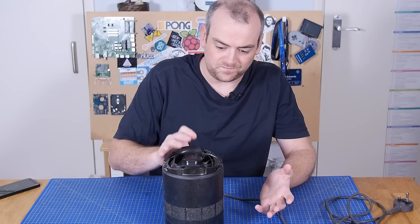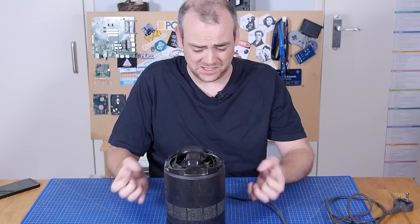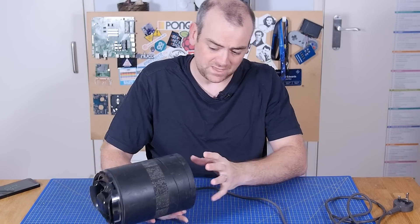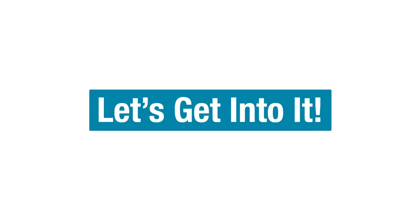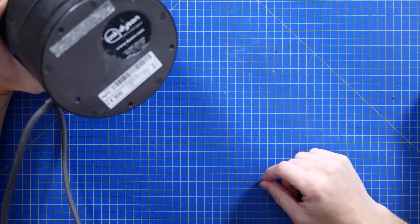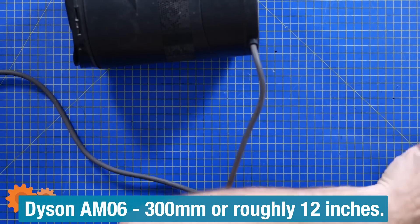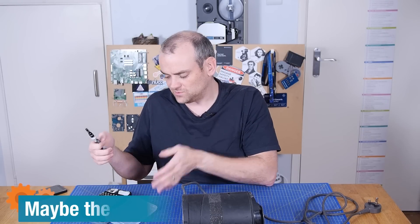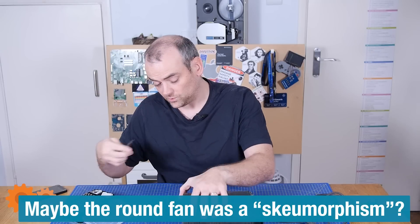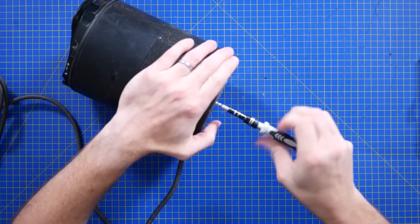This one is clearly missing some bits, it's very very dirty. I did actually turn this on and even in this state it threw out a couple of dust bunnies just out the top. All it's really got is a power button. The specific model we have here is an AM06 300mm, which makes me think it was one of the original generation round ones. I don't really know why they went for an oval shape later — if you're not using a rotating fan there's no reason for it to be round. It saves space and footprint for potentially the same volume of air.